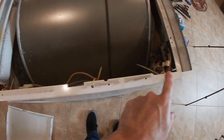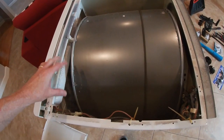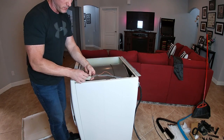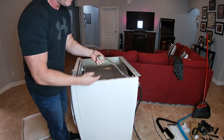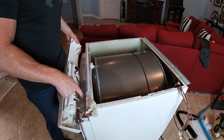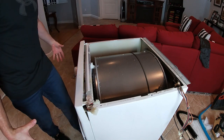Once you've got your top off, you're going to have some zip ties holding in the wire harness that goes from the back to the front panel. Since we need to take this front panel off, we're going to remove the zip ties so we can disconnect this harness and pull the front panel off. Now you have access to your wire harness - it goes from your plug and cable all the way to your front panel. I'm going to disconnect these - you can't screw them up, one has six and the other has two. The only reason I'm taking this panel off is so I can clean all the dust and garbage underneath it. You can just take the screws that are in the metal out and pull the entire front panel off.